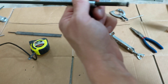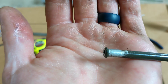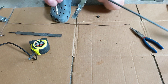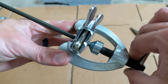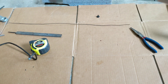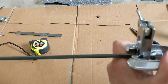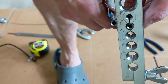I got that cleaned up a little bit. For the first half there, it's just a nice bubble going around — nothing looks chewed up, bent, or torn. Back in the holder. Just going to put one drop of oil on the cone. Now reinstall it — the cone just threads right in there. This one you drive the cone down; you want to watch it and go down until it seats. You don't want to go too incredibly over tight because it can crack that flare. Our new flare looks about the same as the factory flare on the other end of the tube we cut off — the double flare is folded back in on itself. We're going to call this good and move on to bending.